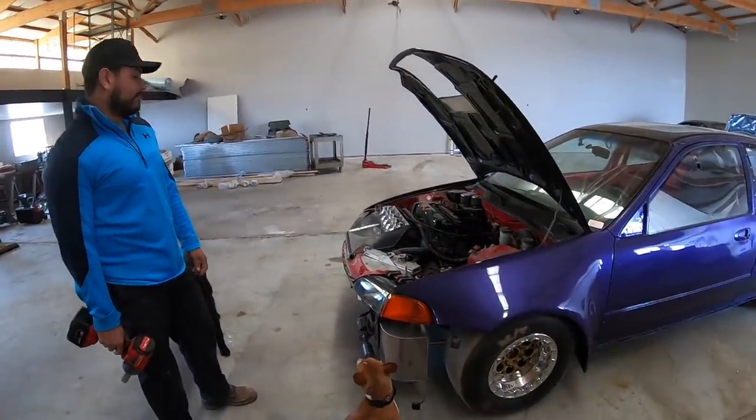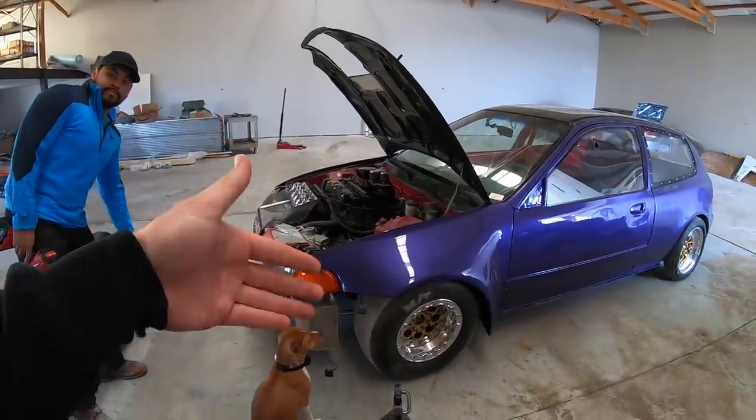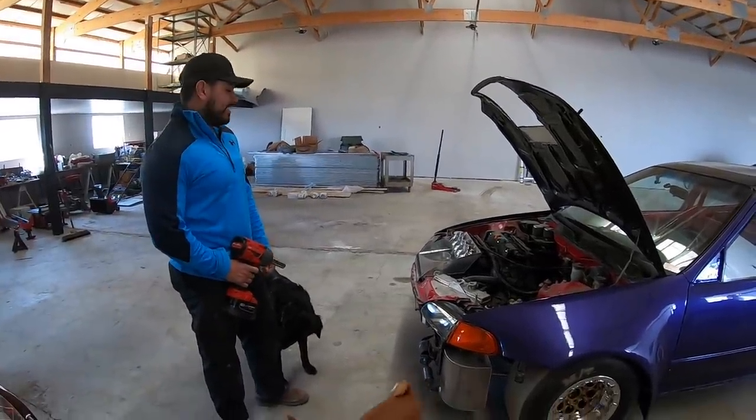It's all good. We're going to start off pretty simple. Just take the tranny out. We've got to put it on jack stands, take the wheels off, take the axles out, take the tranny out, and then I guess we'll assess the damage. Ready? Yeah, I'm ready.